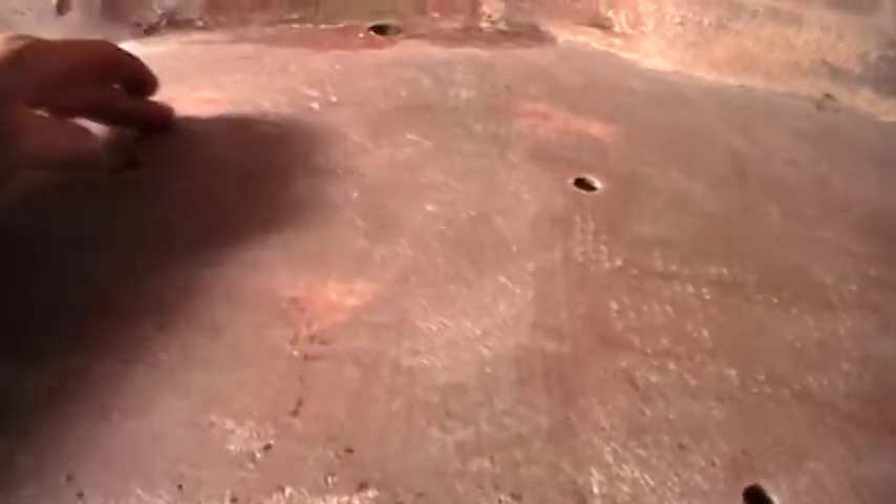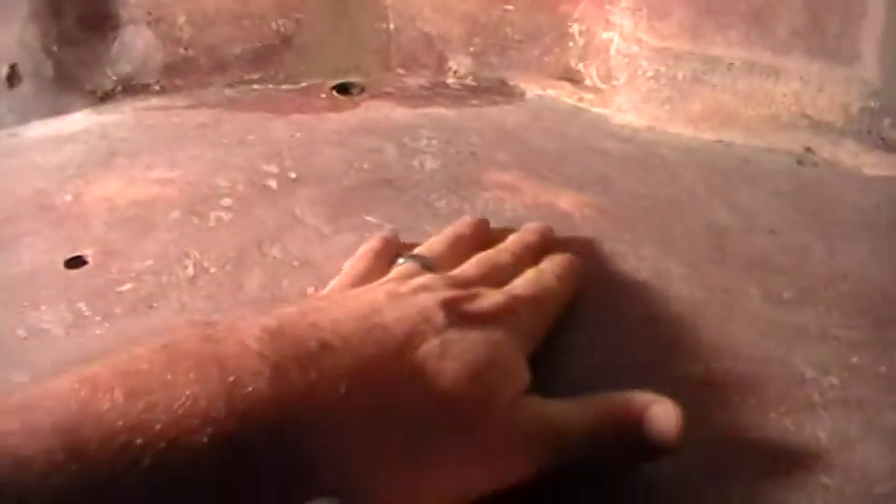And this one is right here — there's a little indent in there. What I'm assuming is where there was a void on the inside of the transom. This void was in the middle, right here, where the fiberglass wasn't good. When the motor pushed forward, you can feel a little indention — barely, I mean a tiny indention on either side. And I'm assuming it just pushed in and stressed the fiberglass in those spots.